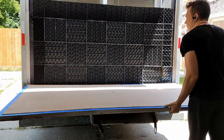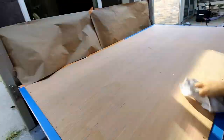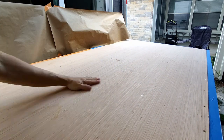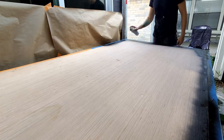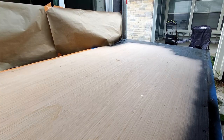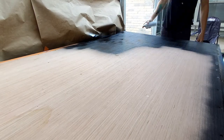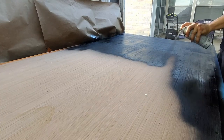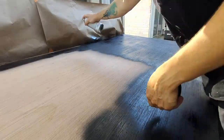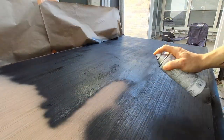We've got to get these tiles out of the way and prep the surface for some paint. Since those tiles do have some gaps in them, you can see through them to the surface below, so I want to make sure that surface is as hidden as possible from view. We're going to paint it black — this is also going to help protect it from the weather. I opted for spray paint here just because I wanted it to be quick-drying, and I didn't want it to be so thick that those tiles would scrape the paint off through vibration over time.